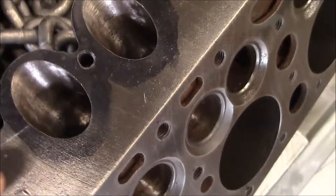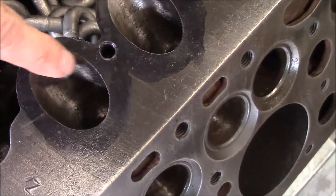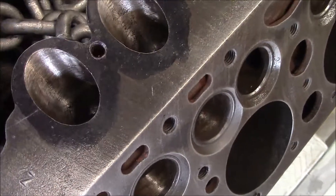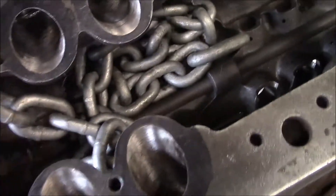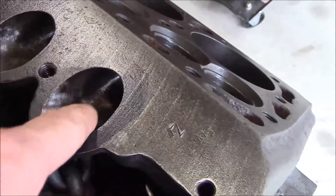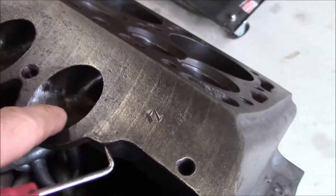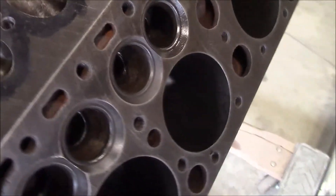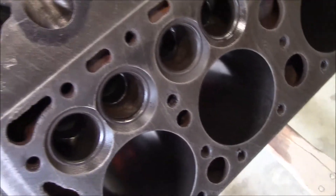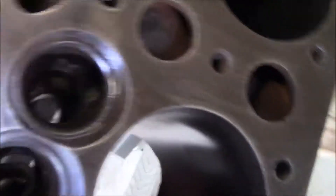You can see it right there — that's metal that you want to remove. I did that on the block side. I haven't got to the intake manifold yet, but I really didn't have to remove much at all on the block side. Just a little bit on this inside lip here, and on the runners I basically just removed all the casting.